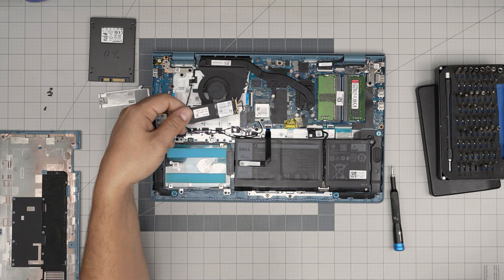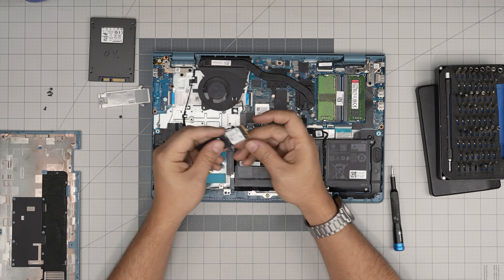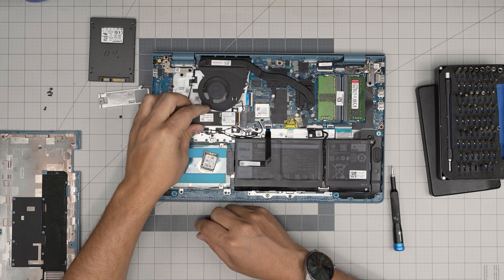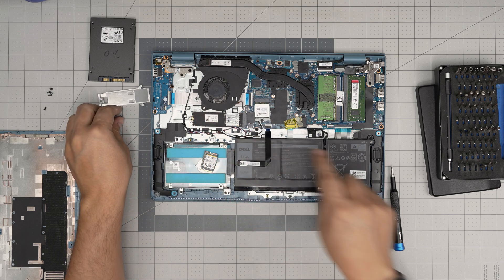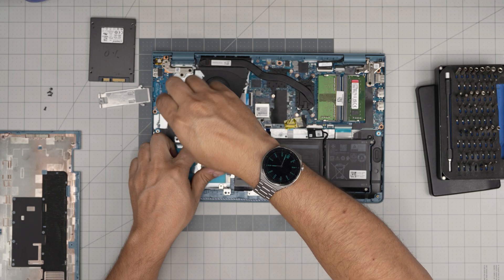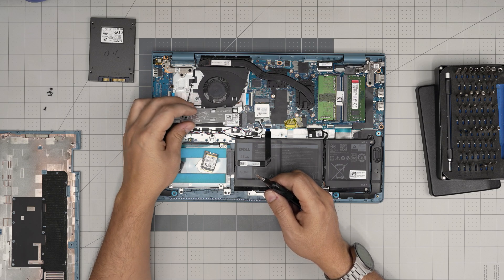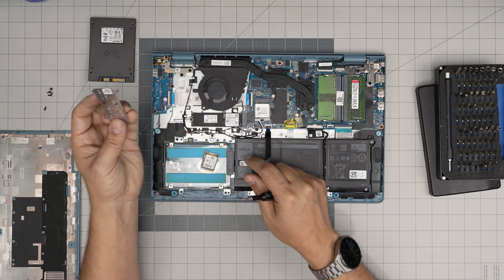For a good brand, the Samsung 990 Pro or 980 Pro are recommended. On the NVMe there's only one notch, and there's a corresponding notch cut in the slot. Bring the drive in at a 45-degree angle into the connector, push it in, bring it down, and the screw hole will match. Put the screw in to secure it. If you're installing a full-size SSD, you don't need the extra extension bracket — and if your drive has a lot of capacitors it could cause a short, so just leave it out.